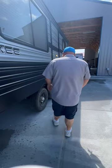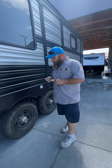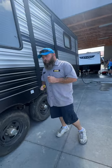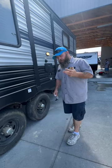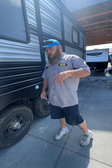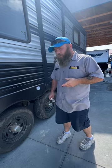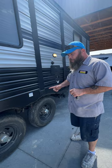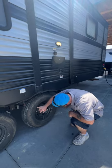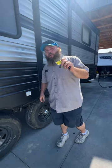As we go a little further along, we have our tires — there will actually be new tires put on this afternoon. After 50 miles I recommend you check the lug nuts to make sure they are torqued to 100 foot-pounds. After that it's recommended at 50, 100, and 200 miles. When you leave a campground and stop at the gas station to refuel, you can also check the lug nuts — knocking out two birds with one stone. Keep these tires topped off to your max PSI, which looks like 80 PSI on these — but please confirm that with the new tires.